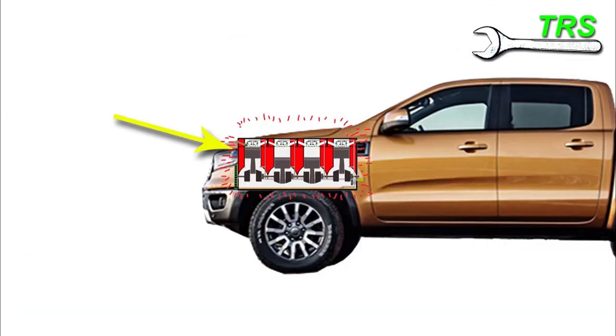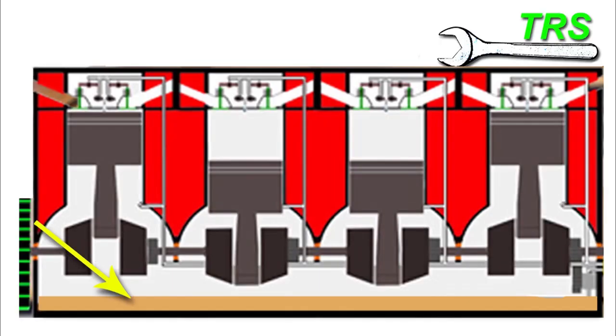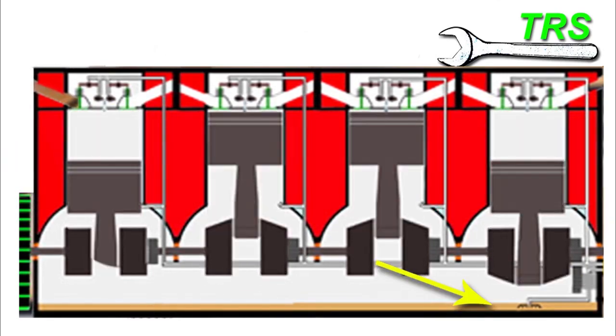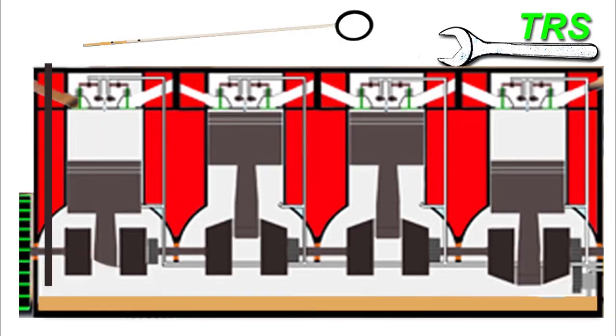And then the next thing I'd make sure of is that the engine is turned off. And that's because the sump oil at the bottom of the engine is always being used. We've got the oil pump that's always picking that oil up and taking it to the different parts of the engine. So what we want to achieve is for all the oil to be still and present at the bottom of the sump, to take an accurate measurement of how much there is. My recommendation is always turn the engine off.